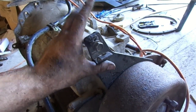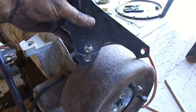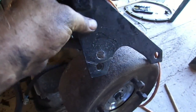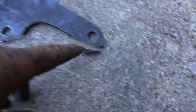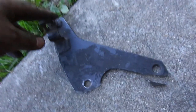I would try and raise it up because it was actually hitting the bottom of the bus floor. So what I did is I bolted on with those two bottom holes. I drilled this top hole here and I scored up here, so I'm going to bend and break off this tab, which is going to lower it down. I ended up having to cut off another piece right here because when I moved this down, this tab was running into the transmission. So let's give that a try now.